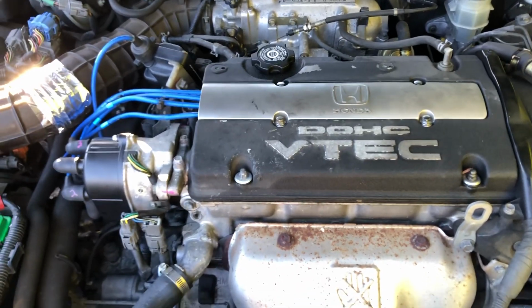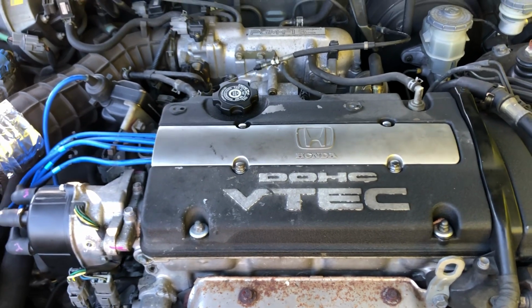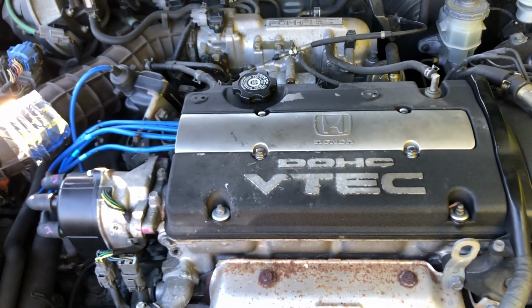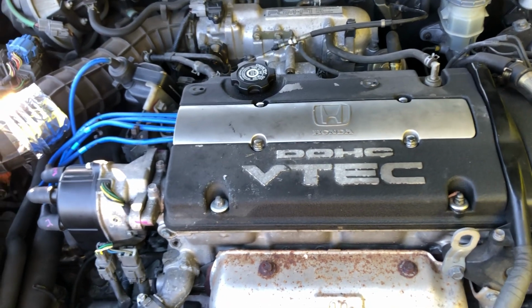Finally I had fuel. I pulled the spark plugs and there was fuel all inside them. They were dark and black and fouled out looking. So I figured, now that I have fuel, I better put some new spark plugs in here and see if this thing will boot.